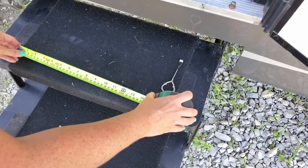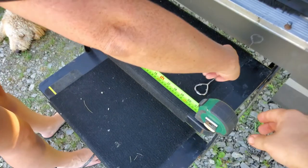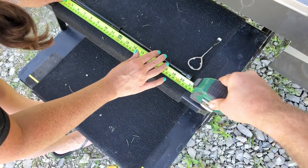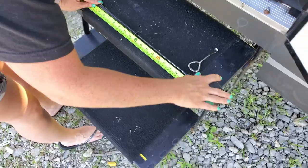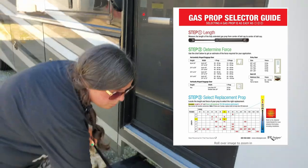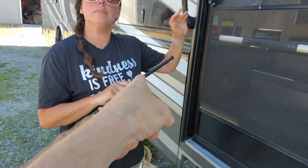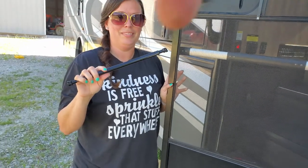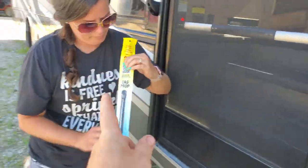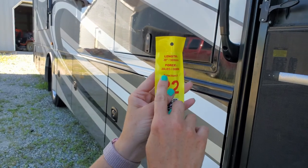There's a chart and you find the one that's closest to your measurement. Now I'm going to pull it apart and measure it extended end to end — it's just over 20 and a half inches extended. So 12 and a half inches closed and about 20 inches extended. We will link the gas prop we found in the description below — it comes with a chart. We went ahead and found the one closest to our measurement. The total length on this one is 20 inches.